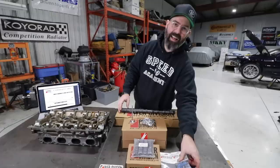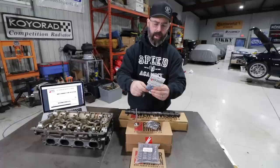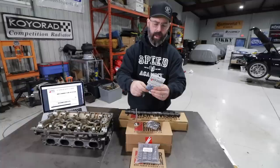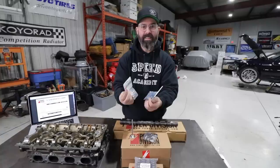Beneath the camshafts we will be running GSC valve train components — standard size intake and exhaust valves, back cut to reduce weight for higher revving, flow tested for maximum flow over the head shape, with a unique swirl finish on the back side and a micro-polished shaft for freer valve motion. They use a special metal — slightly different alloy in the intake versus exhaust valve for different heat loads — meant to upgrade durability and allow higher revving. Titanium retainers for weight savings, and their TVS springs to avoid coil bind at higher RPMs. Also upgrading with their valve guides and Viton valve seals — new technology versus the 20-year-old Mitsubishi seals. One thing we're not doing that we did on the STI is porting the head.